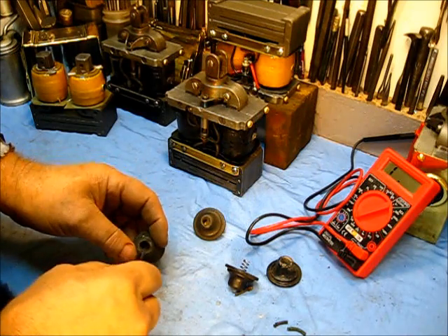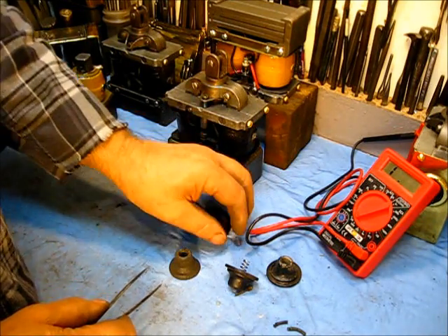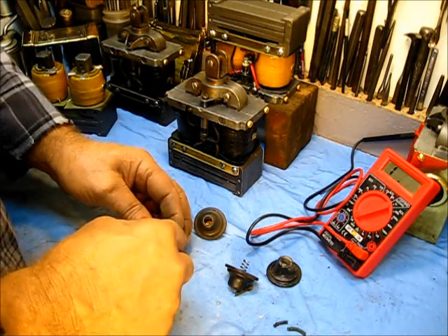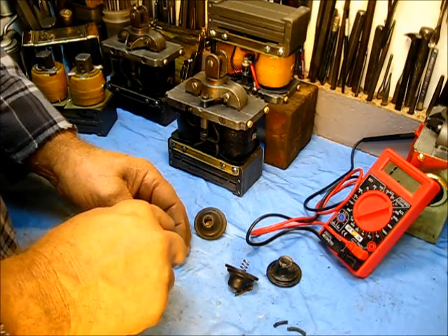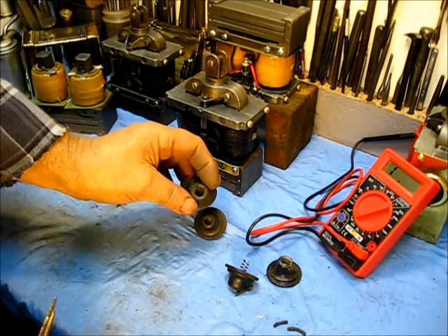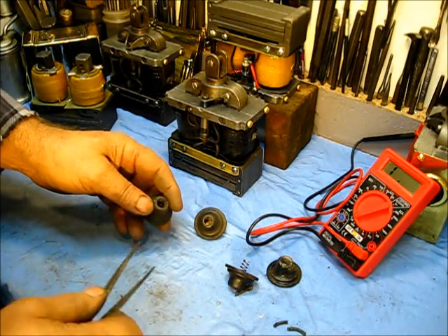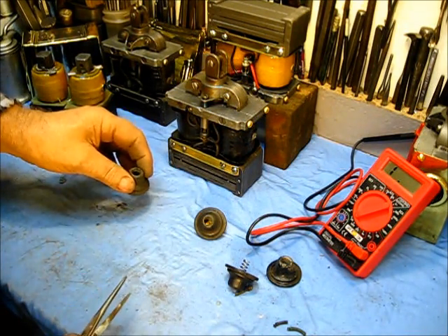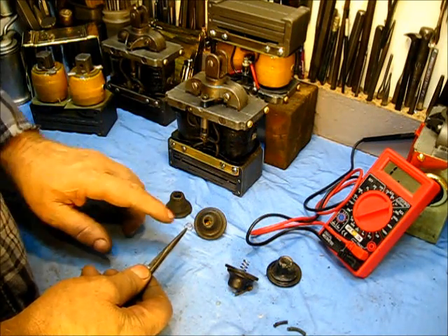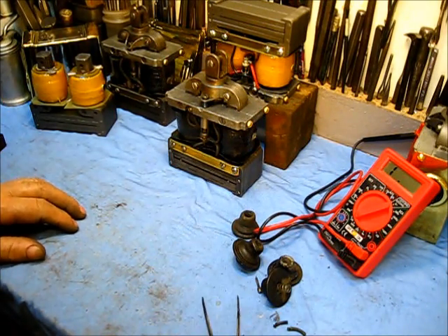This older one was really good in its day. It's got the same straight shot inside, but it has an undercut in there for a little coil of wire — it's brass. That would go down into the terminal and flower out when you get it down in there; it expands into the undercut and won't come out, won't fall out. It would make contact on the spark plug wire that had the brass connector affixed to it. Most of them you'll find now, that little coil of wire will be corroded really bad, but you can clean it up and it'll be like new again. Those are a few of the terminal types you'll encounter.